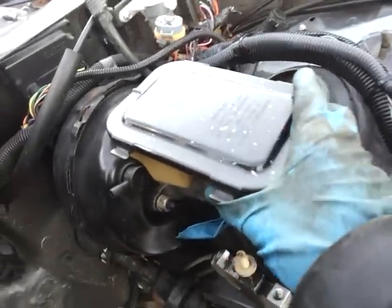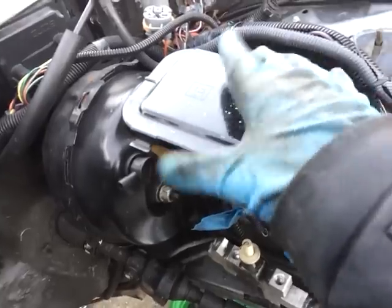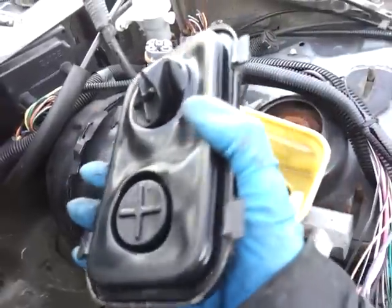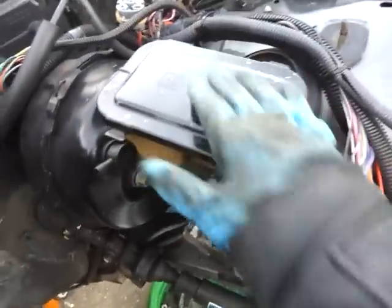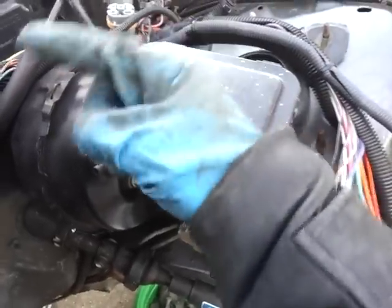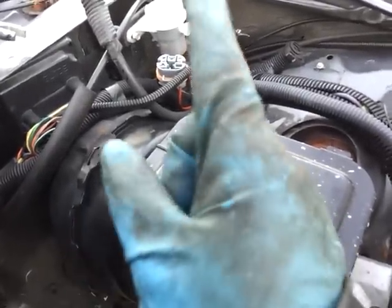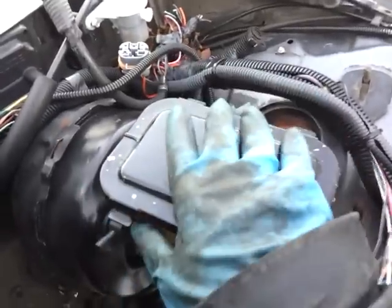Also remember, keep a look out for my video on how to bench bleed this. Like I said, you don't have to bench bleed it — you can just fill the reservoir all the way up with brake fluid, put the lid back on making sure the rubber is on top, then clip it back on. Go inside, press the brake with the lines cracked open and keep doing that until you see brake fluid come out. A good rule of thumb is to start from the back — the farthest point from the master cylinder — and bleed there first. Crack open that bleeder, keep pouring, then work your way forward.